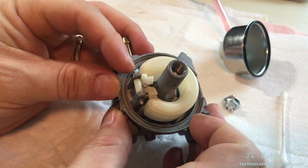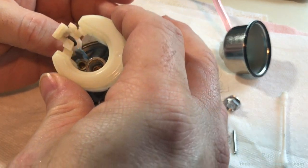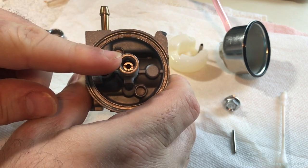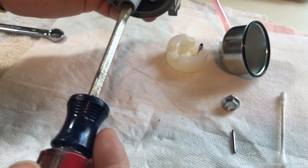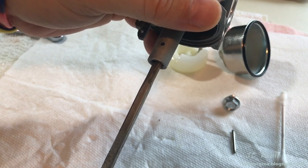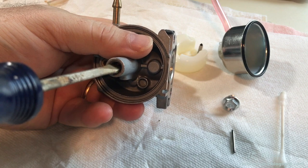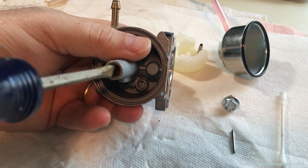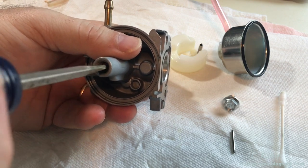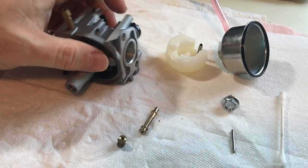This is the float — it regulates a consistent amount of fuel in the bowl. We remove it by gently pulling out this pin, then lifting the float right out along with the needle assembly. The needle itself is rubber. Next we pull the jet in the middle and behind it the emulsion tube. Take extra time to use a correctly fitted screwdriver so you do not destroy the brass — be very careful or you'll ruin it. Once correctly fitted, gently turn the jet out. If it's in really bad condition, you might use a thread-loosening compound or mild heat. Note the jet number before you start in case you need to drill it out and replace it.